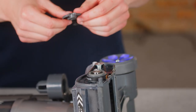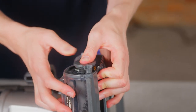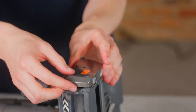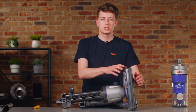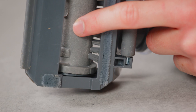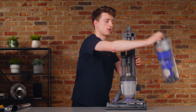Refit the brush bar location plate and then the brush bar cover, and replace and tighten with the screws. Check that the brush bar turns smoothly and is lined up correctly with the square recess before using the machine. Refit the dirt container and the handle.